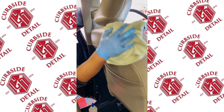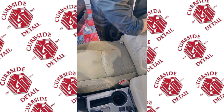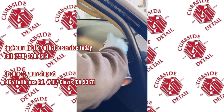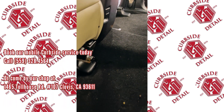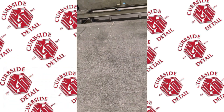You can see how much dirt we're pulling off of the plastic. We steam cleaned everything just to get it as clean as possible, then after that we applied our leather conditioner and dressed all the plastic as well. For the inside vents we use Insta Shine, which is like a dressing in a spray can — helps us get into tight areas and makes it look brand new and helps protect everything.